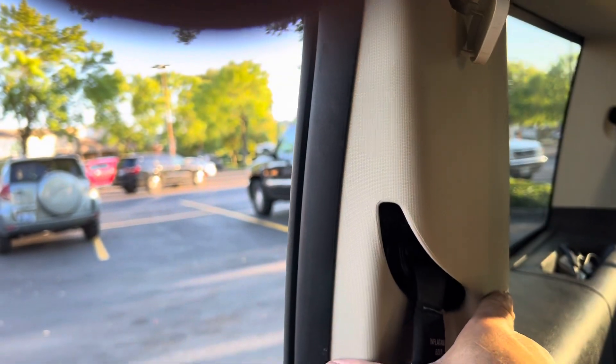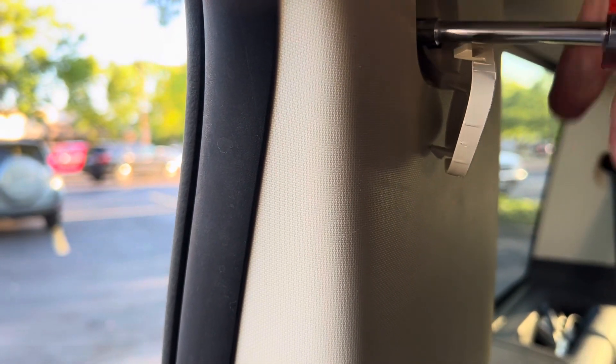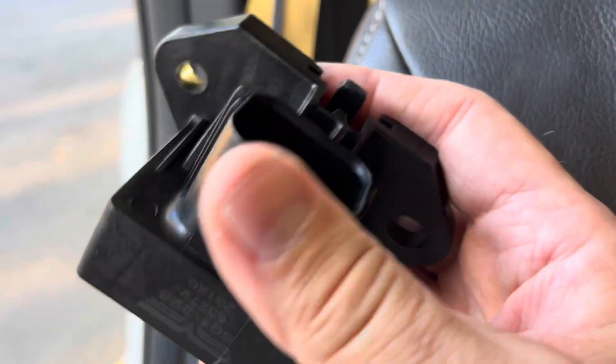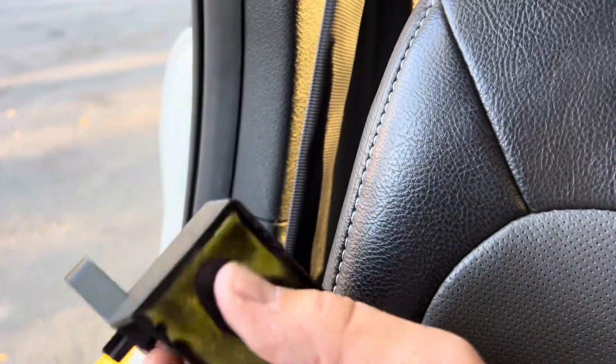What you need to do is — this is the post behind the back seat door, the back door. You just pop this open with a screwdriver. There's a seven millimeter screw back here. Take this screw off and you pop this column off. It's a little plastic that holds the whole thing on. And that relay is right behind there. You need a 10 millimeter to unmount it. Then put it back on, unclip this, clip it back in and you're done.